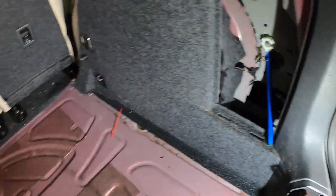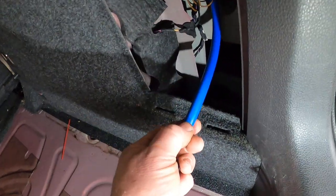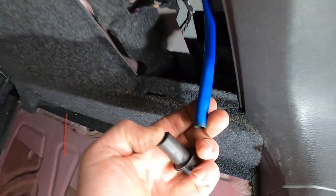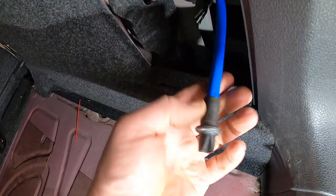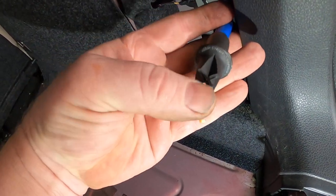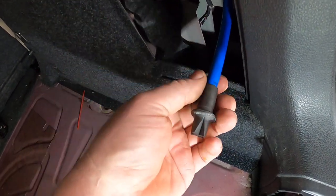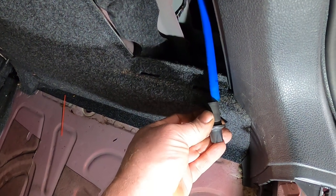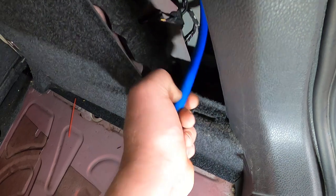What has happened back here is the same thing that happened in the front: these rubber hoses have shrunk. I believe that black mark is how far this is supposed to slide up in there. This is the bug guard, so bugs and spiders don't crawl up and make nests. They were both unplugged — sitting about that far out — so they shrunk about an inch, maybe an inch and a quarter.